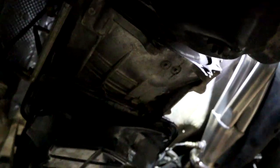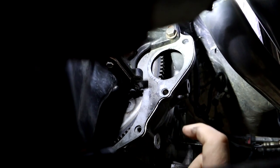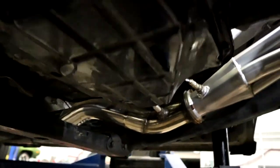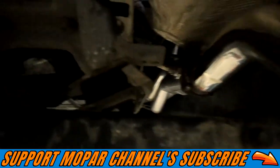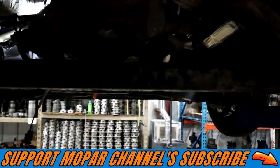As you know, you got converter bolts up here. You can take a long pry bar and stick it up in here, grab these teeth, and kind of roll it so you can get to each bolt — that's an easy method to get to them. Just a little tip there. We still got the cooling lines right here that we have to disconnect. We already got all the electrical connectors disconnected over here. We're almost to the point where we're pulling bolts out of the bell housing — the transmission case — and she's about ready to come out already.